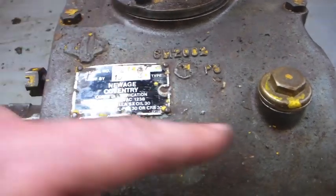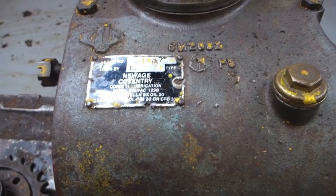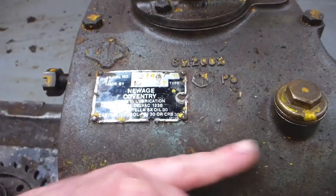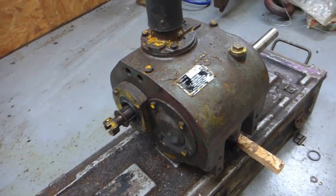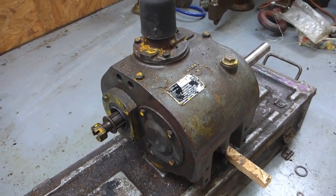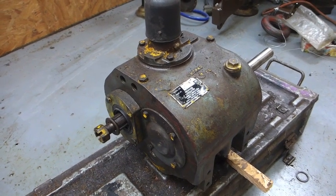These needle rollers are really really small in diameter, almost like little knife edges, and they're the ones that specify the EP oil to withstand the extreme force of these tiny little steel pins running against the shafts. Like many boxes of this age, it filled with water, and there's something about hardened steel that means when you get water on it, it corrodes faster than you would believe — and that's what happened to my box.